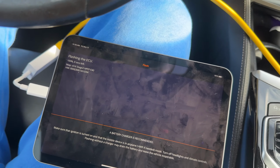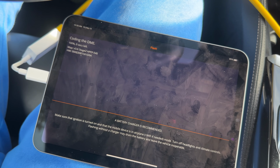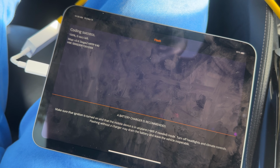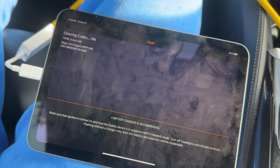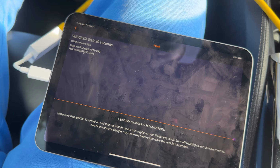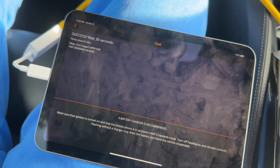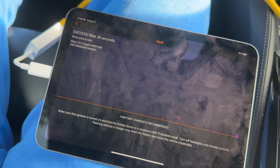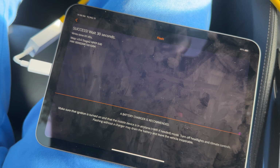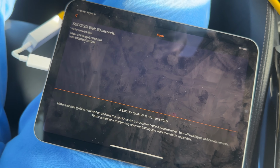So once it flashes the ECU, then it's going to code the ECU. So again, my car's got a downpipe, the TU pump that I bought secondhand, an exhaust cutout, coilovers, and brakes coming soon, and I'm also running E40 ethanol. So if you're looking to do a tune like this, it really doesn't cost much. Altogether with the downpipe, the pump, the software, the maps, it's probably $800 altogether. Maybe $800 to $1,000 altogether. So for just that price, you can have 50% more power out of your B58.